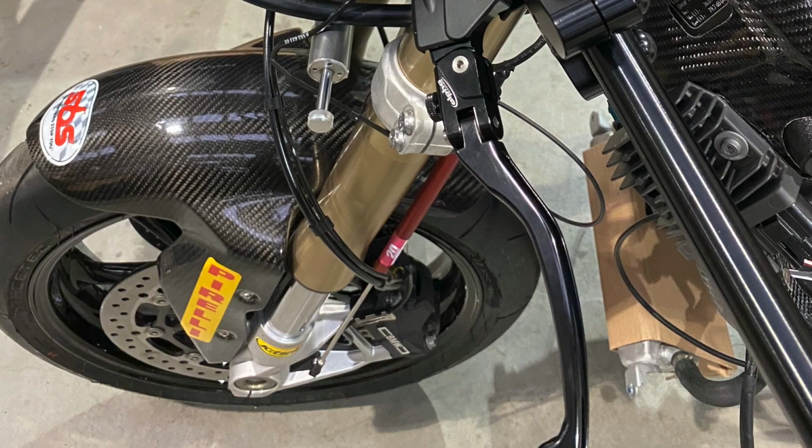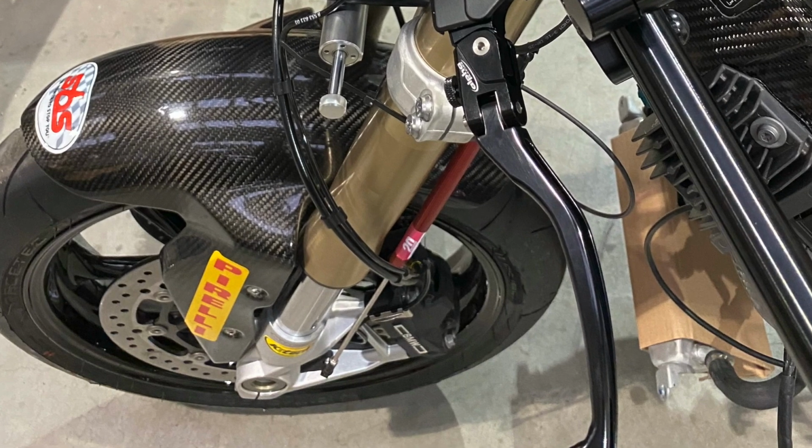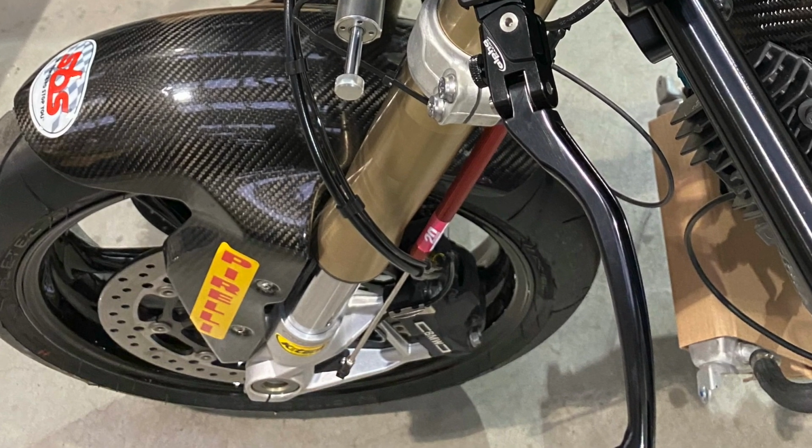You couldn't really use the anti-wheelie on the old bike because it was too harsh, too intrusive. But now you can lean on it. And basically what that does is makes the bike less physical to ride. So every time you accelerate out of a slow corner, you're not trying to climb over the front, trying to keep the front wheel down, you can just pin it. It's still an animal to ride, but it's much more friendly. The brakes are really good as well.